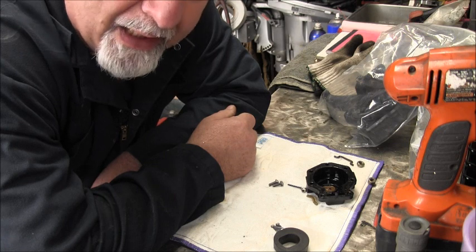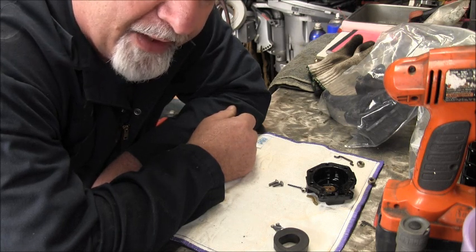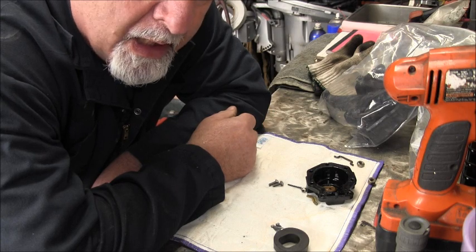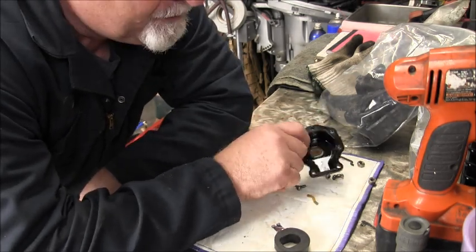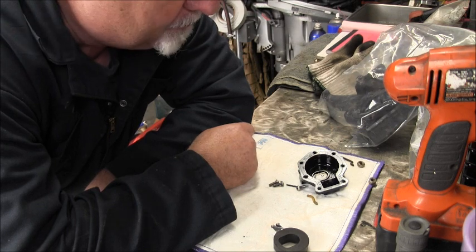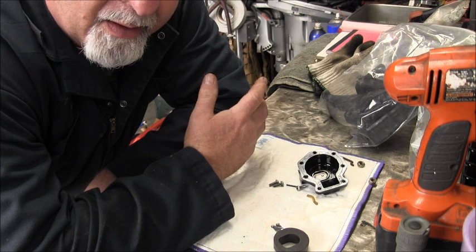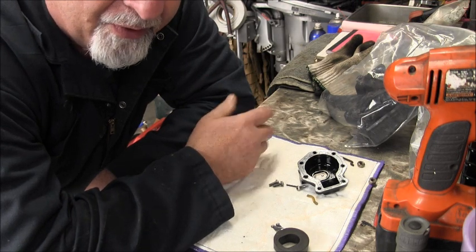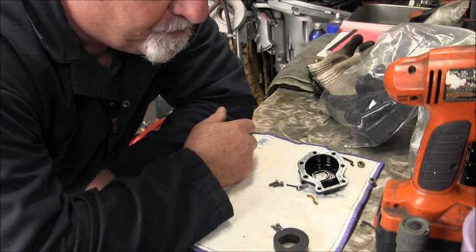I just warm it up, basically, because aluminum expands at a rate three times faster than steel. And when you go to throwing these plastic pieces in there, you really gotta watch it, because they will warp, especially that top. So the top, I'm just gonna buzz it. The water won't even be hot enough to do anything before I pull that plastic top. I just wanna buzz them passages in there a little bit and then get that out.